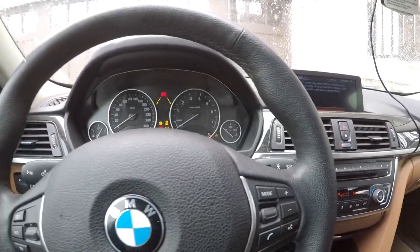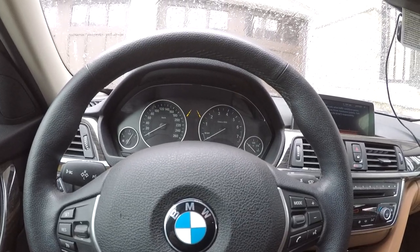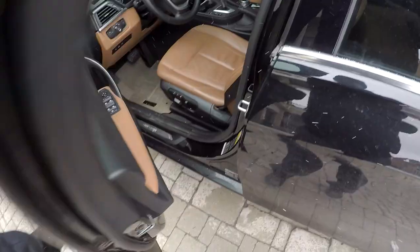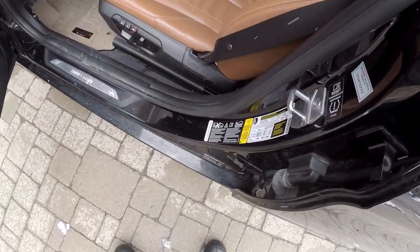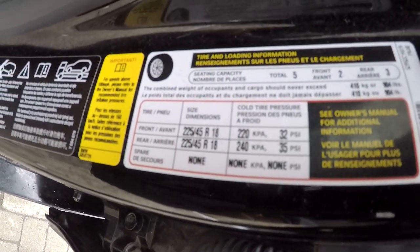The initialization process adopts the set inflation tire pressures as reference values for the detection of a flat tire. It is important to set proper pressure according to your vehicle spec before resetting FTM. You can find the recommended tire pressure for your car on a sticker in the door jam.